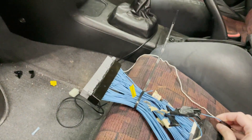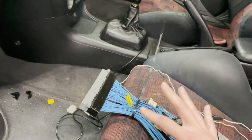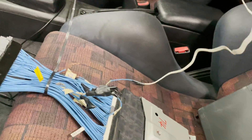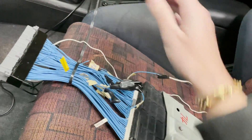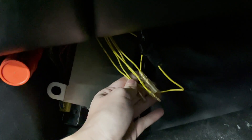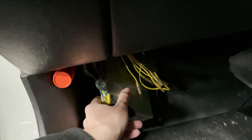One thing I realized the last couple days was that you can plug in the EVO 5 or 6 ECU to the EVO 4 — it's pretty much plug and play, minus you'll need to swap the flash wire at some point. I had a spare EVO 4 ECU and EVO 5 ECU, so I plugged in the EVO 5 ECU. I have no idea what all of these wires are for — there's like a handful of them. Anyone have ideas? Comment below. Pretty much the problem is taken care of, which I will show you.